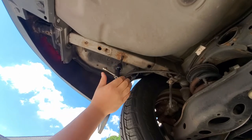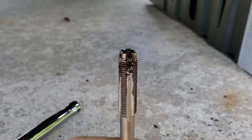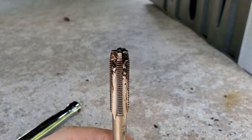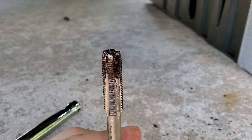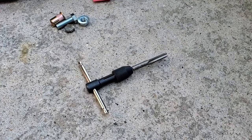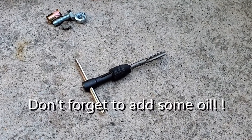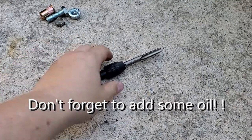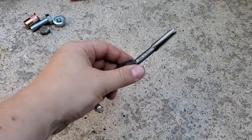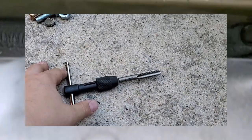If you find your holes really rusted out while installing your hitch, make sure you slowly run the bolts separately — without actually installing the hitch — to thread them through first, or use a tap like this, which will totally save the thread. After running the tap through all my holes, the bolts go in and out so easily, just like they're supposed to.